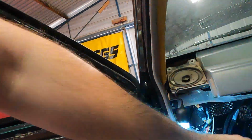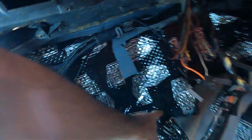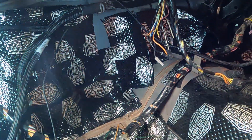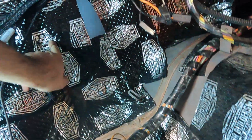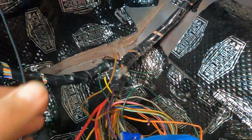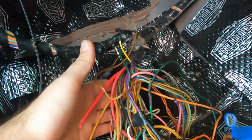But stick around and I'm going to show you guys relocating this fuse box into the glove box. So, relocating the fuse box in, obviously you're going to have to pull that fuse box out. Customer's already done that, but you'll strip apart and then you'll pull the wiring through, I think it's somewhere here. There's usually where the factory wiring harness goes up through and then up the firewall into the bay. And I think the ECU is somewhere over here. So yeah, here we go. So got to get the wiring harness through the cabin, and then you're left with something like this bundle of joy.